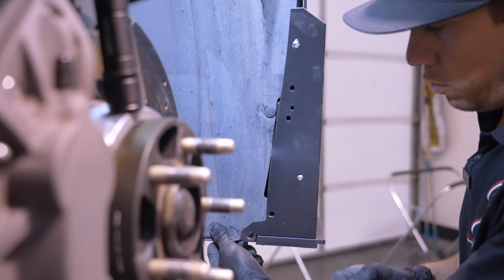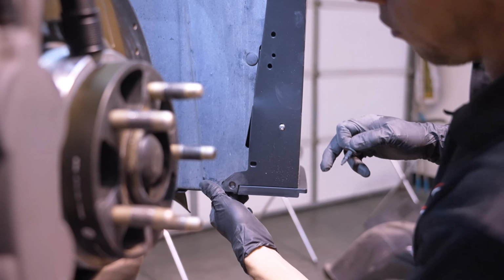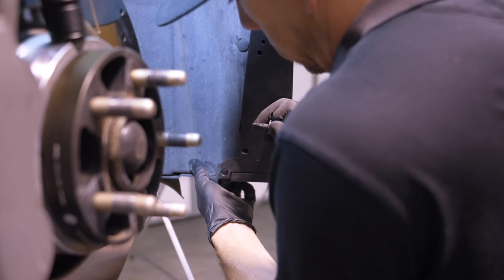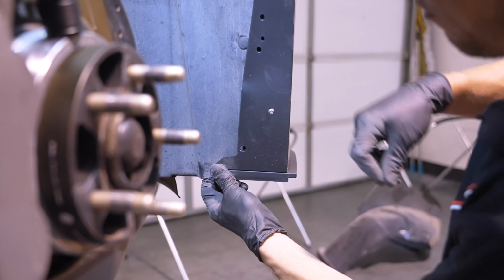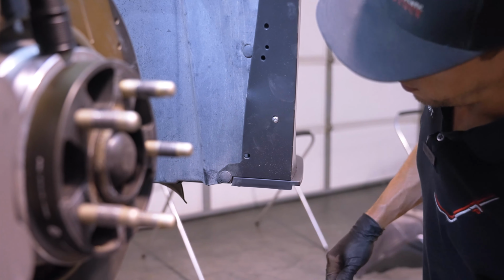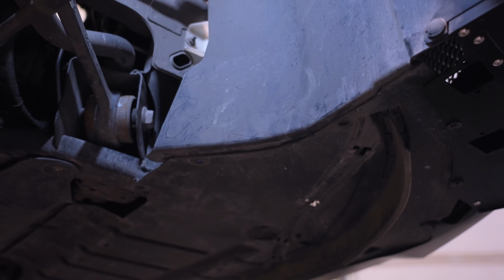This lower one uses one of the larger clips. And instead of where this liner would be in front previously, this is going to go behind, and then you'll be able to push this up to the bumper, get your clip in. It kind of bends a little bit. It's not exactly perfect, I will admit, but that does hold this thing in nice. And then you'll get your 2 larger ones that go back into the bottom of this and tie into the under tray as well. And this thing is nice and secure in here. It should be good to go after that.